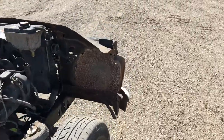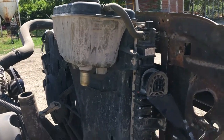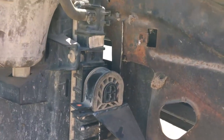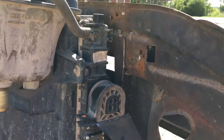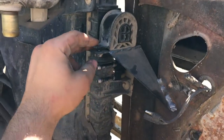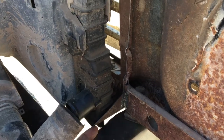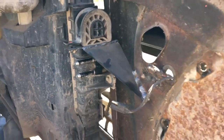It's gonna go into a little bit of detail here just to show you guys how I did some of the stuff. The rad went in really easy — like super easy. All I did was put this little bracket up in here; all it is is a piece of flat metal. There was a piece that came out across here, as you can see — I cut it out. I cut that lip out and then welded this little bracket in here. All it's gonna have is a quarter-inch bolt holding this down and clamping that rad in.